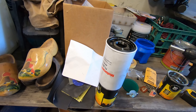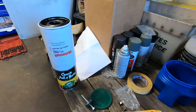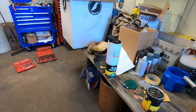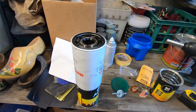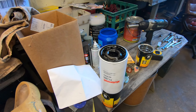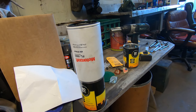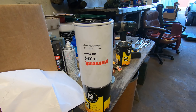Maybe some of you don't know this, but if you're an IDI guy and you look at this filter, you're going to notice it is too big — that's because it's not from an IDI. This is a very common mod: it's an OBS Powerstroke oil filter, and it holds twice as much as an IDI oil filter. The filtration is apparently much better too. There's the part number if you're curious. It's also a lot more readily available at the auto parts store, and they're like ten to fifteen dollars where IDI filters were fifteen to twenty dollars — so there's your little IDI hack for the day.